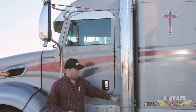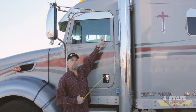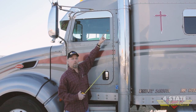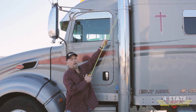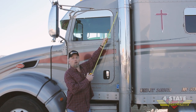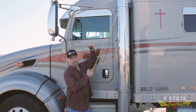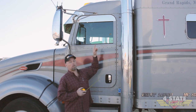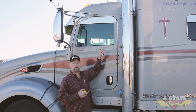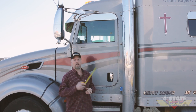To determine the spool length on your 379 or 389 glider kit, measure from the lower cab bracket up to where it mounts to your cab on top. All Peterbilts will have a bracket similar to this one. If your factory exhaust attaches to the lower webbing — the lower side of the bracket — it's a 52 inch spool. If it attaches to the top webbing, it's a 55 inch spool. Upper exhaust mounting bracket hooks to the bottom webbing: 52 inch. Hooks to the top webbing: 55 inch. We've found that to be true each and every time.